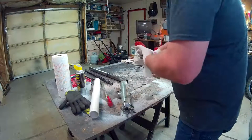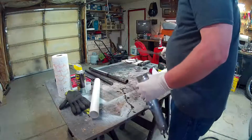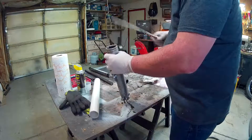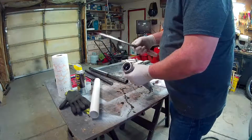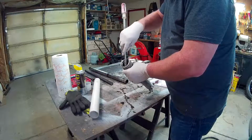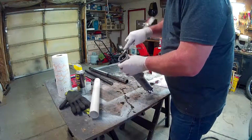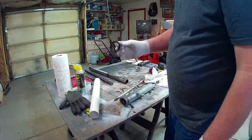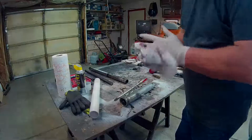So now, the part we're here for, the seal, which is here. What I'm going to do is take it over to the vise and just get in here and pry down on it. Now, you have to be careful. You obviously don't want to chew up the lip here, and since this is obviously aluminum, and this isn't, it could be a problem. So what I try to do is grab just a little bit of the seal so that this flat part here is actually on there. And then I just do a little bit on each side and work my way around until it pops out. Even doing that though, I did manage to screw up this one pretty good. So anyway, that part's pretty self-explanatory, so I'll bring you back once I get that seal off.